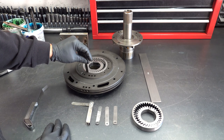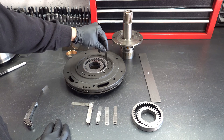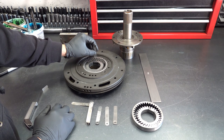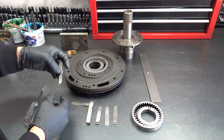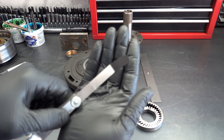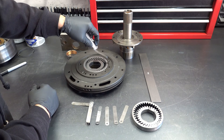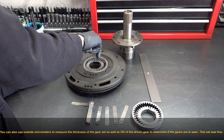This is going in, but it is making contact with both the outer diameter and the inner wall, and it's taken some effort to install to get it fully seated. Now I'm going to come with a five thousandths feeler gauge and go through the same exercise. It's really not wanting to go — I have to force it in, but that defeats the purpose.